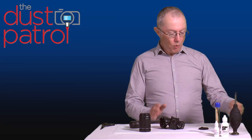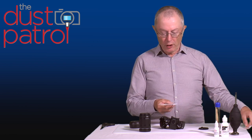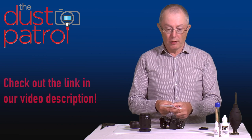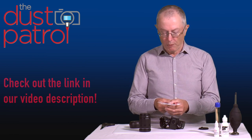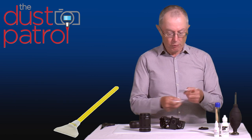Now, wet cleaning involves taking a swab, putting some fluid on it and rubbing it gently across the sensor. Swabs come in three different sizes. They're colour-coded so that it's easy to work out which size you need. We have a chart on the website that lets you check your camera and it will explain to you which swab you need. But generally, yellow swabs are for full-frame cameras.